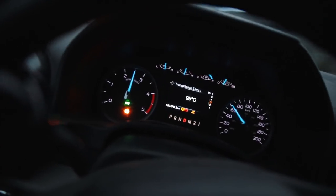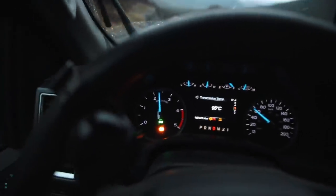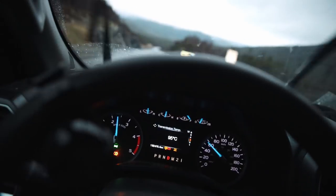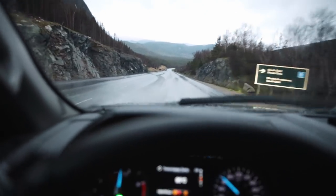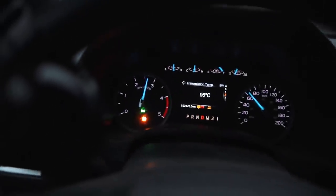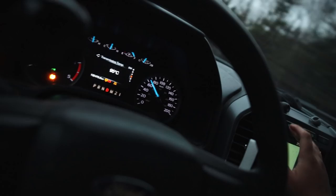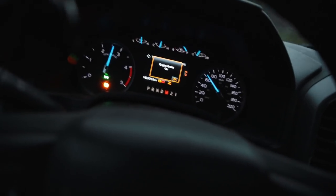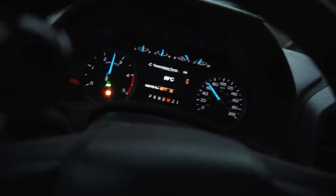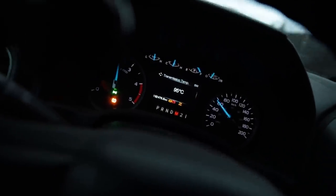Hard on the brakes again. And I'm not getting the engine brake that I want. So now, watch as we just pick up speed going down this hill. This is no good. So, that's why I put engine brake on. We'll get back on the truck brakes, put it in manual, and get her back down to 2200 or 2300 RPM.